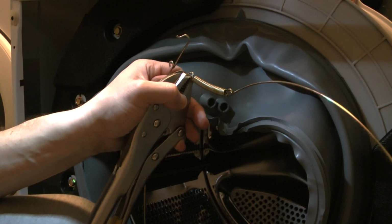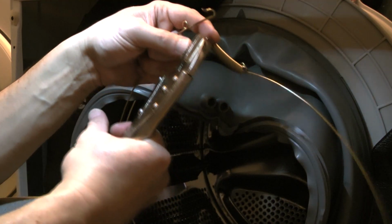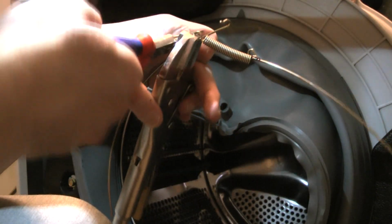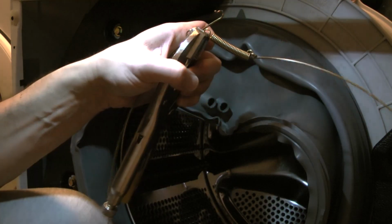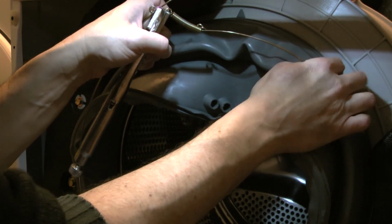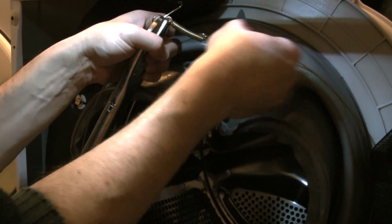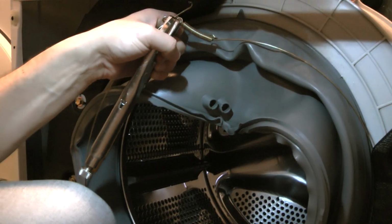Now it's time to place the retainer for the gasket. You can use the pressure plier with very strong pressure on the tip of the spring, and on the other side, I'm gonna grab this with my circular jaw pliers, and then pull back on both. The only thing you need to be absolutely certain of is that the retainer is in the proper groove. Otherwise, you damage your gasket, and you also need to be careful because if it's not on the groove, you have to put extra pressure in there. But there's a lot of pressure attached to it, so it is something I'm gonna do offline.